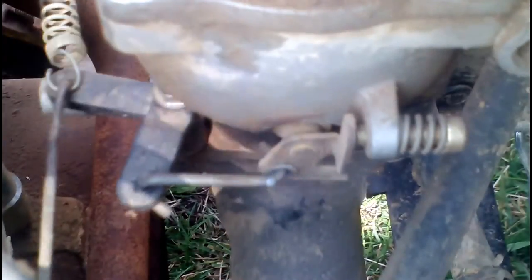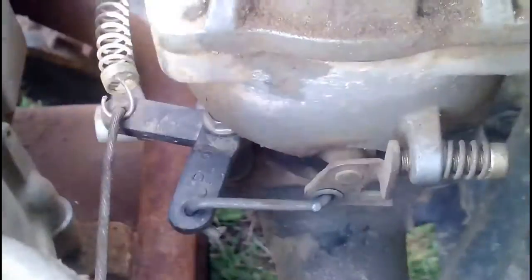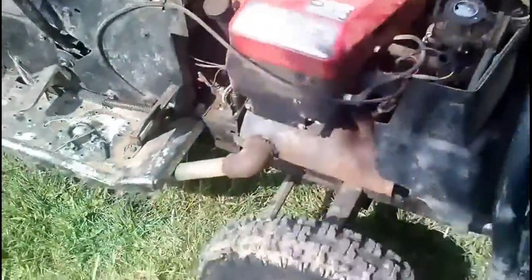So now we can watch our throttle action. There's the gas pedal all the way down, there's up. That completely bypasses the governor. The governor itself is down in there — you can see the stubs sticking out for it. But we've removed the arm and all the linkages off of it. So that's one way we do it on this tractor.